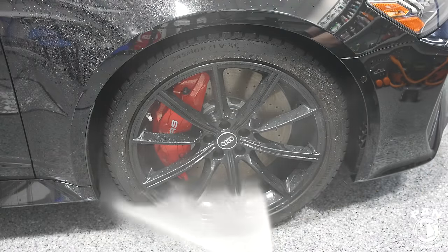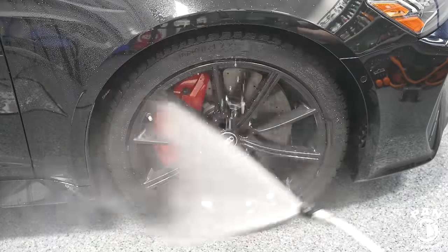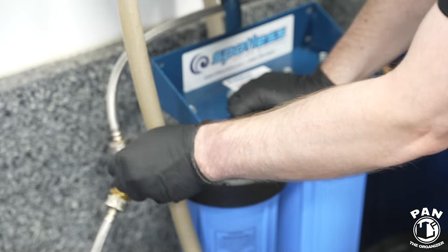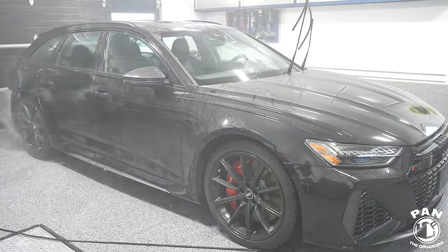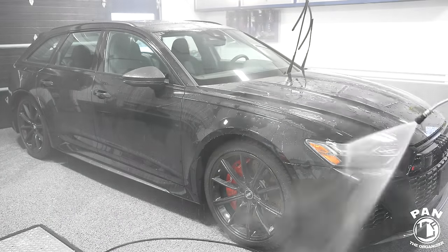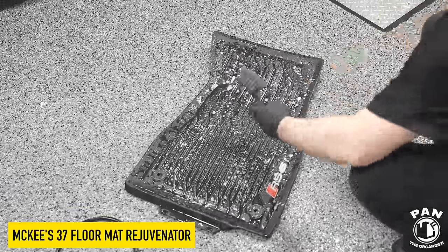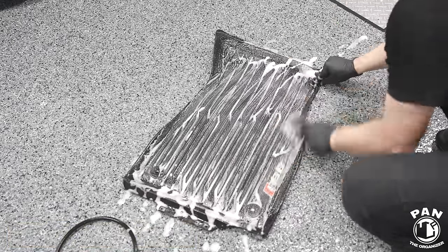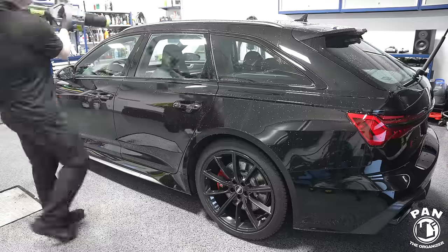For the wheels, even though it's not a wheels-off detail, I still want to over-deliver, so I applied DIY Quick Beads — a graphene-based ceramic spray. Spray on the surface, let it dwell for roughly 30 seconds, rinse from the bottom up, and you get hydrophobic properties. For the final rinse, I used my CR Spotless water deionizer, activated to give 100% mineral-free water for a spot-free rinse. Then I also cleaned the rubber mats using McKee's 37 Cargo Mat and Rubber Liner Rejuvenator — spray on, let it dwell a few seconds, scrub, rinse, let them dry, and we're clean and good to go.